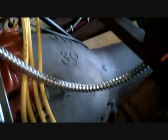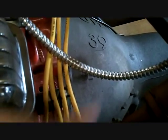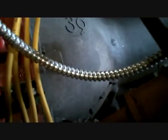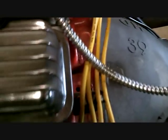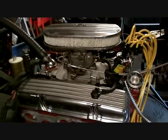I've got the car all the way forward so I've got to walk around the thing. I need one wire that goes from here all the way up to my ignition — another wire to go through the firewall that I'm going to have to deal with later. I actually put some BX cable for the two coil wires. I'm probably just going to strap it to the column. Wire-tie it. My plugs are out. I should have a spark. I've got to put that ground lead on — I'll be right back.